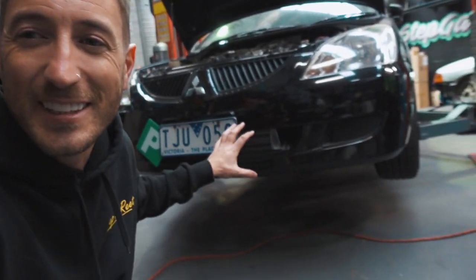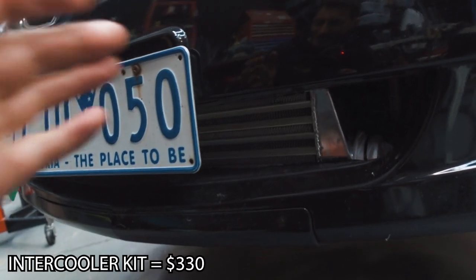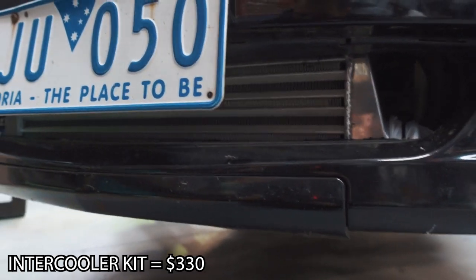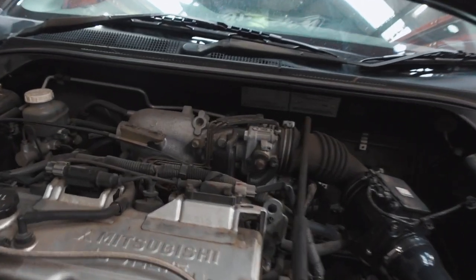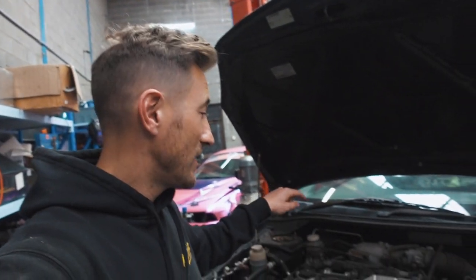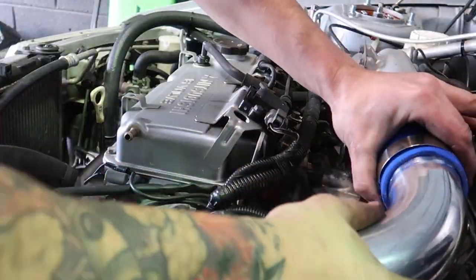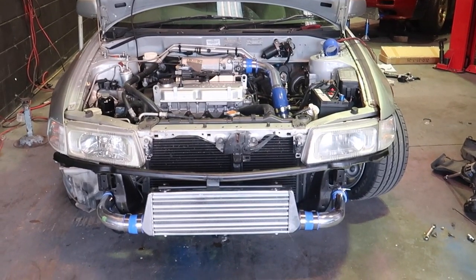The next thing you'll need is the thing that makes your car look cool — in my opinion anyway — and that is the front mounted intercooler, which you can see right here. This is highly recommended because it keeps the boost going into your intake manifold nice and cool. My intake manifold actually used to get quite warm, so the intercooler played quite a big role in keeping the boost cold and us actually making the 160 kilowatts we made with the Fevo. The higher your intake temps, the more chance you'll get detonation within your engine, and your tuner won't be able to tune the power into your motor, so definitely go for the intercooler. The link to the intercooler kit is in the description.